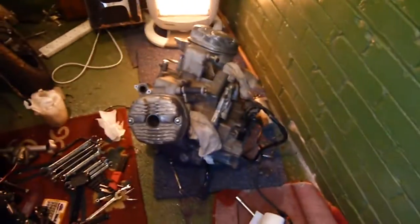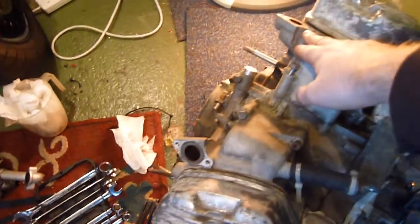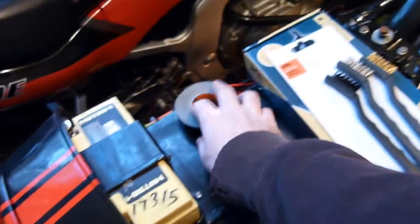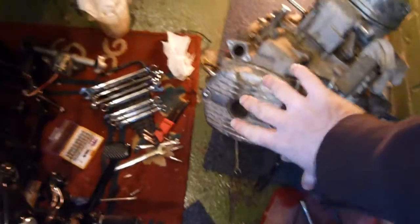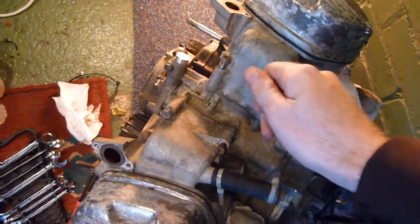I'm back and I've got a few items to help me in my engine painting adventure. First, I've got some duct tape to put on all the open ports going into the engine — where the starter motor was, the water flow tubes for the coolant, and any other bits — to prevent water getting in. I've got masking tape to mask off the heads and anywhere I don't want painting. I've also got a selection of wire brushes. The first step is basically just roughing up the surface and getting any oxidisation off — any rust or bad oxidisation we'll take off with the brushes.